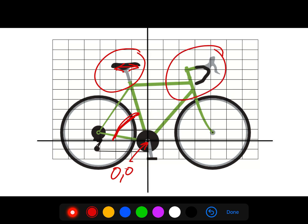We're also going to discuss the handlebars. So we can, with any given bike, with any given stem, move the handlebars up and down. But if we go to a real bike shop or do things ourselves, we can also change the stem itself to make the handlebars go out further, come back closer. And if you know more about handlebars, you can actually buy different types of handlebars that affect how far out your hands go. Then the last one that I know you guys have already talked about in class would be the cranks themselves. They are going to move our position around the bottom bracket a little bit. So I will at least talk about that slightly just because I've done some research in the area of crank lengths myself. Hopefully you'll be able to see it published in a little while.